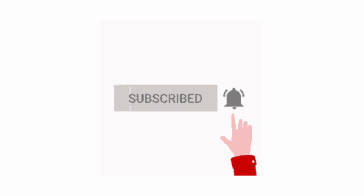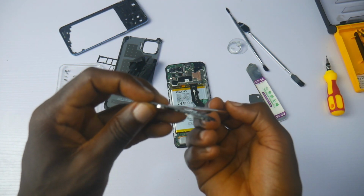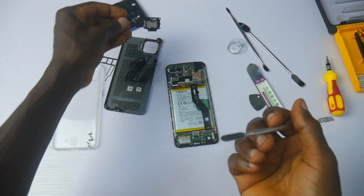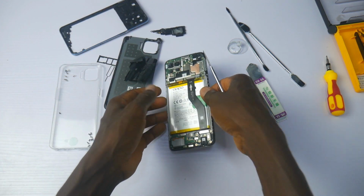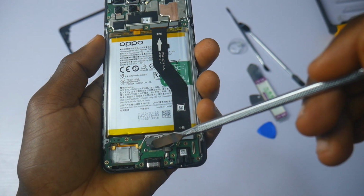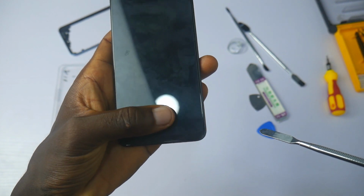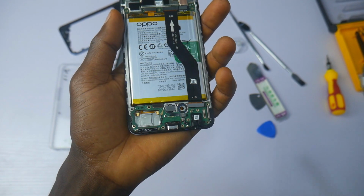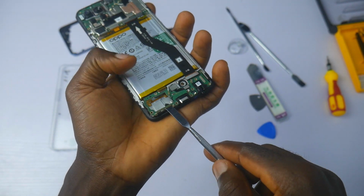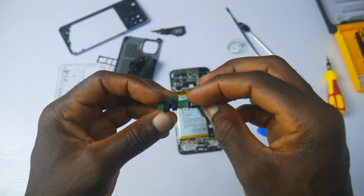The first part of the bottom shows the speaker and vibration module, and again, they are thin. A careful look and you will see the under-display fingerprint sensor neatly tucked inside the bottom motherboard. After unclipping all the ribbon cables, it was easy for the bottom board to come off, which again is very thin. The USB Type-C and 3.5mm jack are attached to this board.